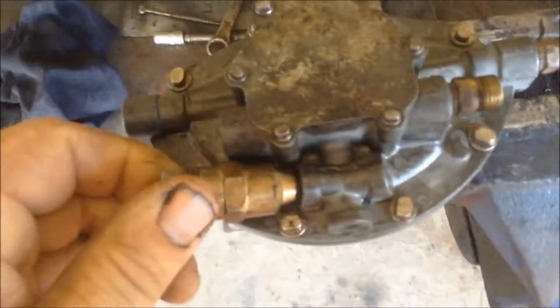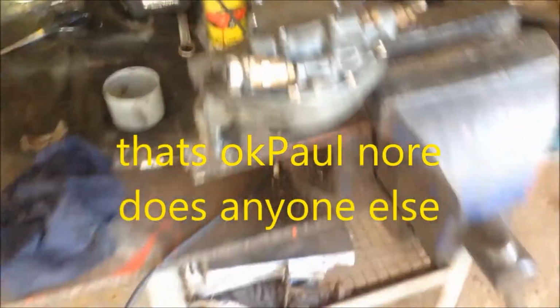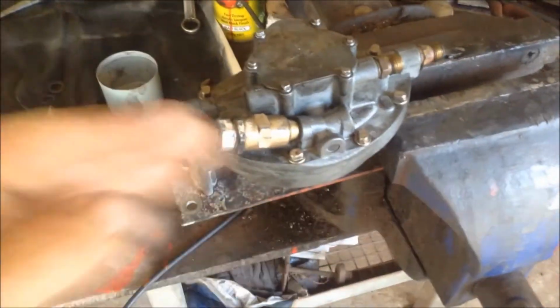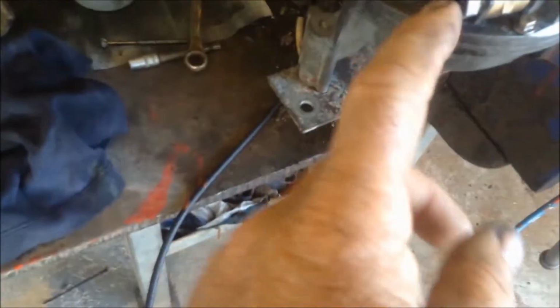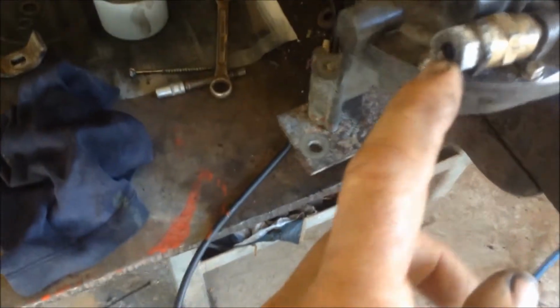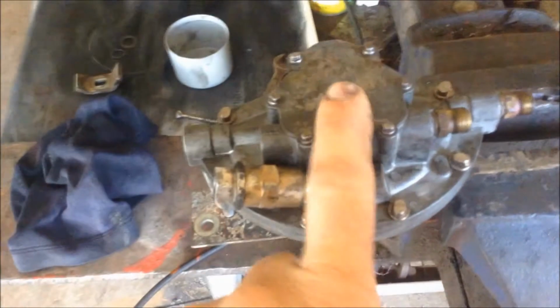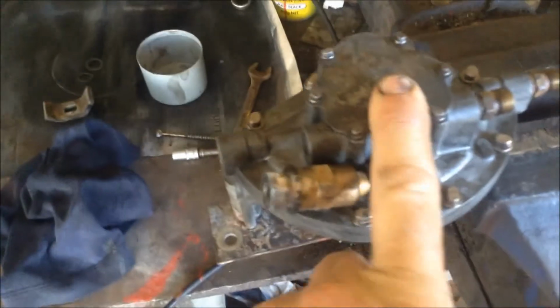Not much anyone knows about these. I don't know much. This is the air-operated windscreen wiper motor. It would only go one way and stop, wouldn't return. Now I've pulled it all apart and had a look, and I actually found the problem was this vent was blocked off with a mud wasp, had I been more observant. So there's a couple of things to sort out inside here because my memory's not as good as it should have been. But we'll work that out as we go.